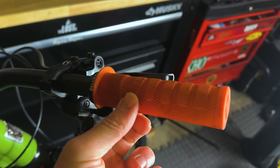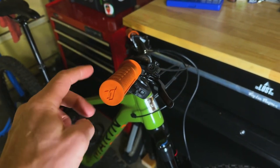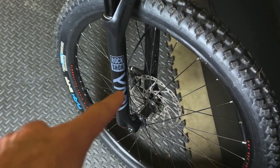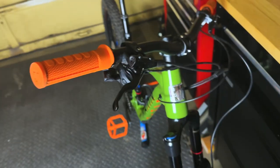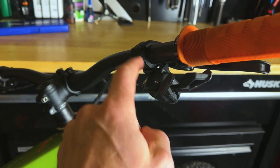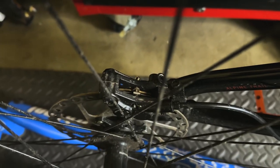I've got the Hell's Gate grips — these are my new favorite grips by Trail One. Really cool design; I'll throw a link in the description and a discount code from Brian at BKXC as well. For brakes, this is the Shimano MT420 4-piston brake caliper — a 203mm rotor up front, powered by the 4100 brake levers. They're two-finger levers; one-finger levers come on the fancier models. I like that even as a budget bike it comes with the Shimano I-Spec EV setup, where the shifter mounts right to the bottom of the brake lever. In the rear it's got a 180mm rotor, spec'd with metal pads.